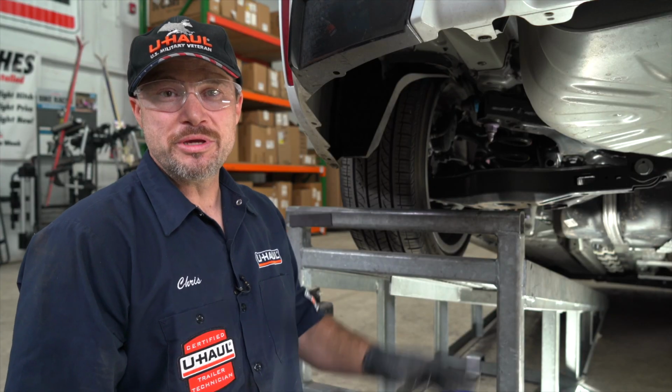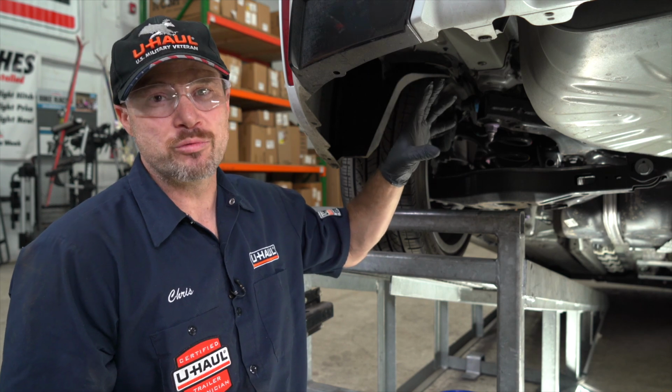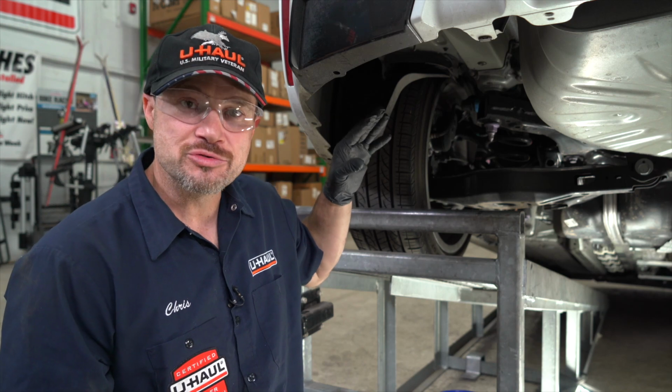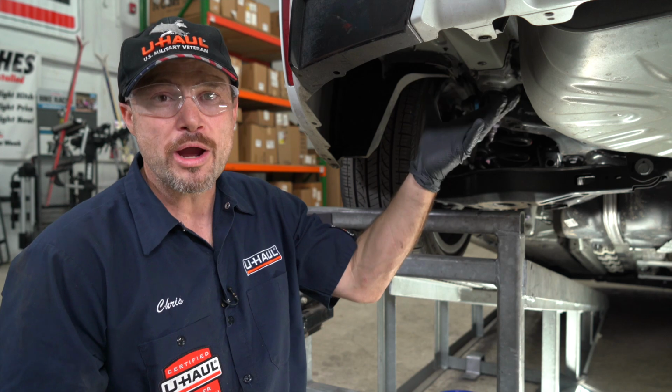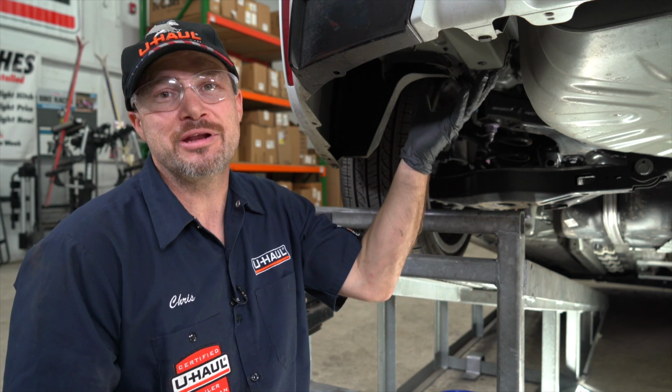The next step will be the removal of the underbody panel if present. As you can see, we do not have one. There will just be a few push fasteners you need to remove with a flathead screwdriver or a trim panel tool. There's also a cut the underbody panel will require. You will need to follow directions to make this 2 1/4 by 11 1/4 inch cut.